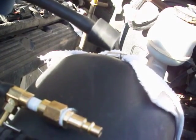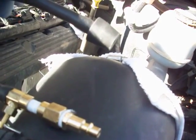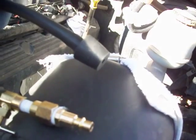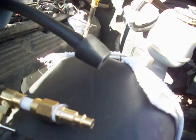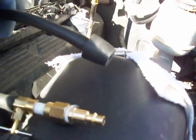Then I'll get underneath and turn the crank with a half-inch breaker bar and an 18mm socket on the front end of the crankshaft, slowly turning the engine over by hand. Eventually it'll hit the point where the valves go closed. When they close, the cylinder seals, air pressure builds up, and it'll pop this little cork out — you'll hear it. So I'm going to get this jammed back in, get some air hooked up, and start turning the cylinders around.